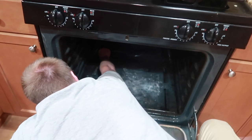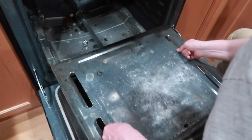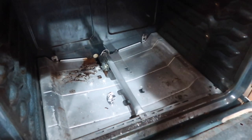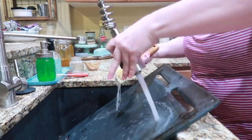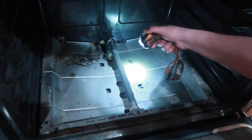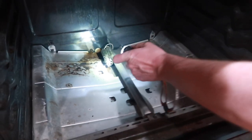So you're trying to unscrew that now? That's what I have to do to get access to the underneath part. Nasty. I guess I clean that now? There's the little part. Maybe all that gunk is what's damaged something. This thing's supposed to glow - that's the glow starter thing. It's not even lighting up. This one up here lit up when we did the broil. Yeah, it turned on. This one isn't even glowing. Let's see if there's a breaker for the oven.